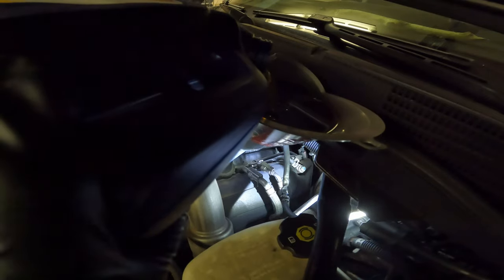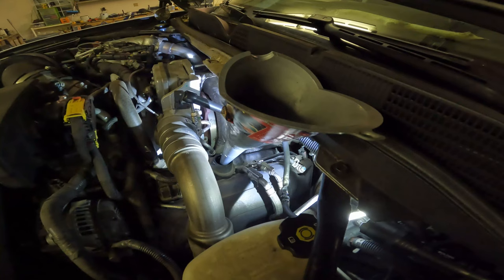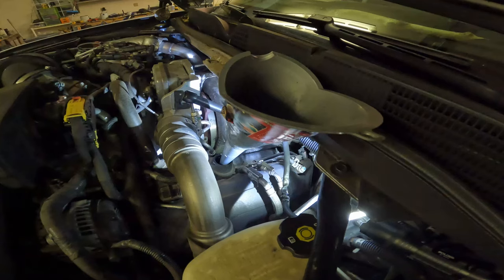So I used to add 11 quarts of oil. It would take like 10.5 to perfectly put the oil up on the dipstick, but I was adding 11 because I was using 5W40, so it would be a little bit high for a little while, and eventually the truck would get rid of the extra oil. I don't know if it would eat it or what it would do, but eventually it wouldn't be too much oil. Now I use Hot Shots Stiction Eliminator. So I do the 2.5 gallons of oil, and then I add maybe 20 ounces of the Stiction Eliminator, and that brings it to the perfect amount of oil. So I'm going to measure that out.